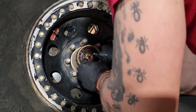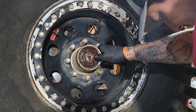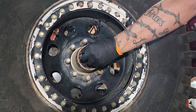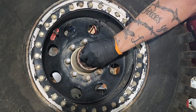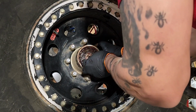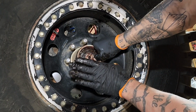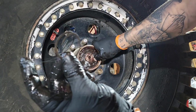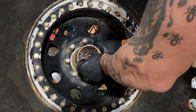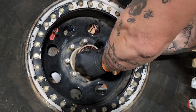All right. Now I feel like I had to grab the axle or bring the axle this way. Oh, I don't want to grab my plier with these hands. Let's see if I can move the axle. Right there. I think I made enough room. All I did was put my plier behind the U-joint on the axle, slide the axle like 1/8 of an inch forward, so I have enough room for this disaster of a spacer. This is what my body gave me, okay? At the discount that I got this, not gonna complain.